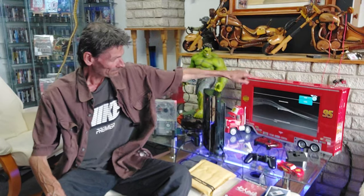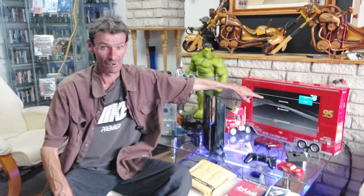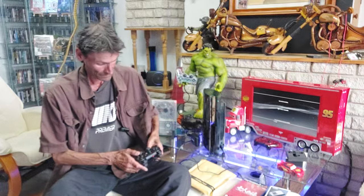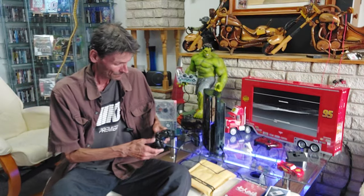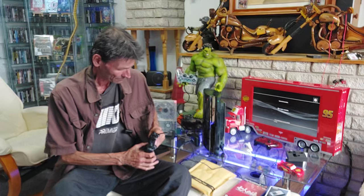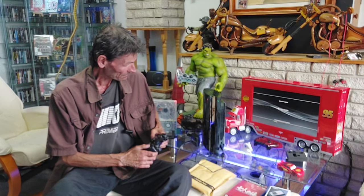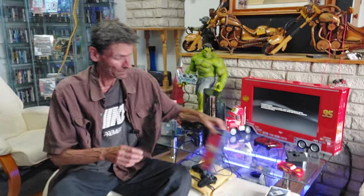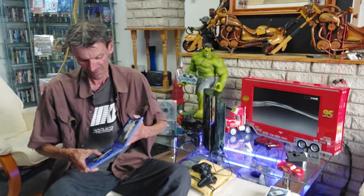See — it says there: 'set the time and date.' Now it'll come up every time you turn it on because the CMOS battery is totally dead. I'll just make sure the disc is in it — it is. Put this in now, see if it loads.